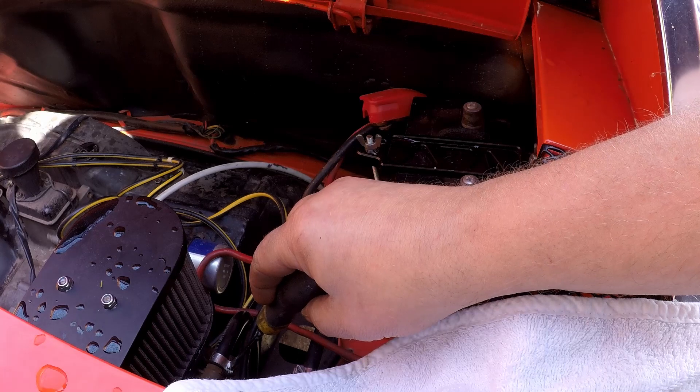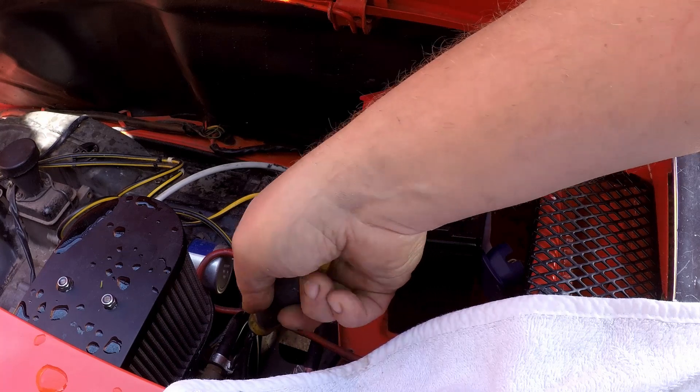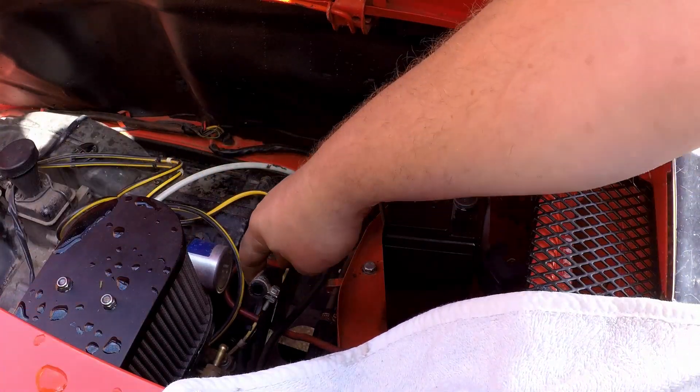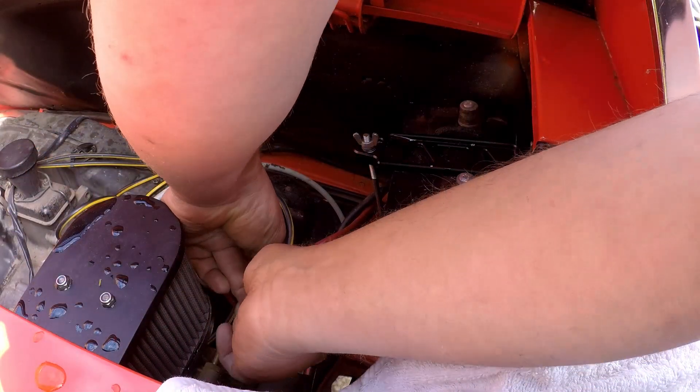While I'm up here I'm going to disconnect the fuel system and take these carburettors off. Looks like it's got dual Webers. I'm going to put a bolt in there — going to find a slightly wider diameter bolt. Because it's running Webers it's got a little bit of play on there. It'll be interesting to see how that relates to the actual pedal. I'm going to disconnect that from there, which looks like a little side bolt, and that's been pinched. Then I'm going to undo the carburettors.